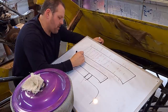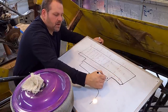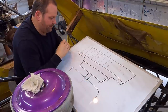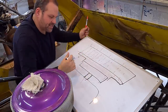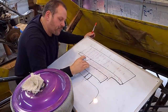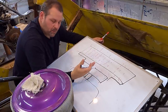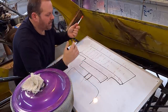When we have this shroud, all right, and I'm going to put it at this half inch, or say 1 inch in like that. Let's just imagine that that fan is 1 inch in, somewhere almost halfway to the fan, all right? The reason for that is because you have a leading edge of this fan where it cuts the air. So you're knifing in on this leading edge of this fan, and in front of that leading edge, you're gonna have negative air pressure to the atmosphere. So the atmospheric pressure right here is lower, and then behind the fan, the atmospheric pressure is higher than it naturally is, okay?